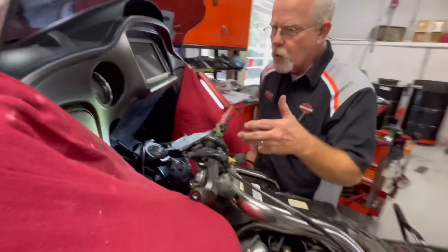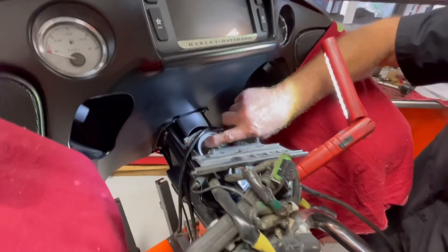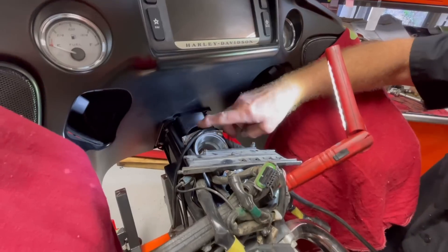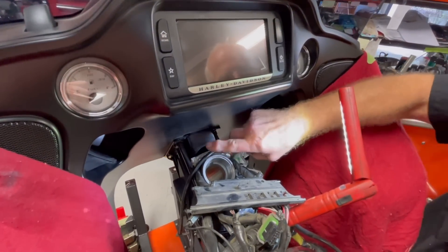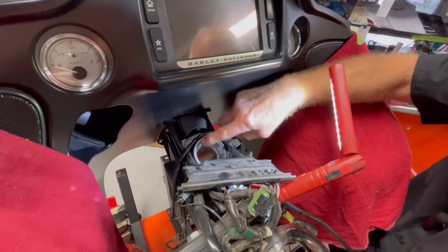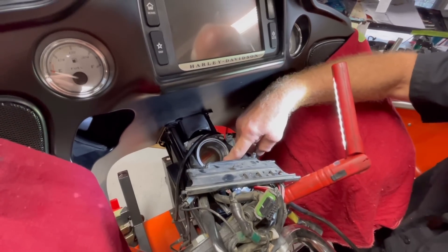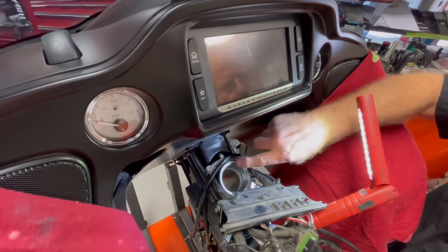On the top side of this Road Glide we have shadowing, but it's a little bit darker, and I can almost catch my fingernail on the front and back — that's where the most wear is going to be from all the potholes and roads, where the suspension is pushing on the front and back as you're braking and hitting potholes. So I've decided I'm going to replace this race.